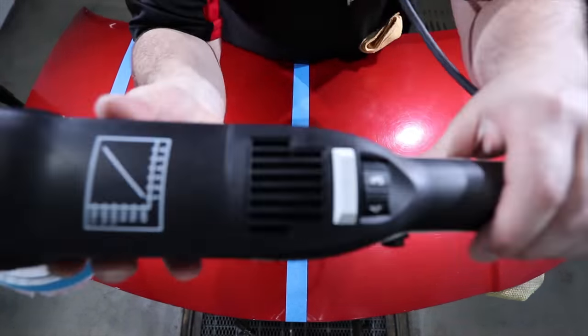So with this last combination and technique achieving the results that I was after, I basically broke down the panel into those same smaller sections that I showed at the start of the video, using my larger pads to correct the larger, flatter areas and my smaller pads for the smaller areas and edge work.